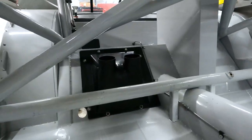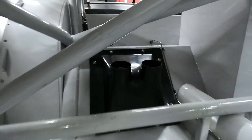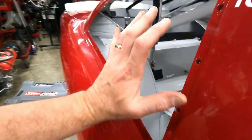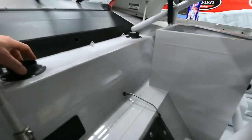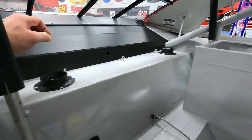Here's our rear gear cooler mount. It's mounted in the package tray. The gear cooler is underneath. You can see it through the duct work. We're going to pipe cold air in from the right side window down into the duct with a dual NACA duct inlet. I've also got my package tray rear brake hose duct work put in as well.